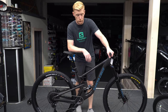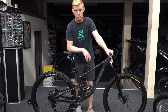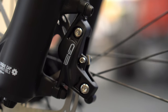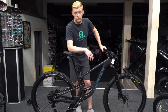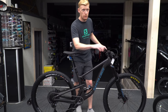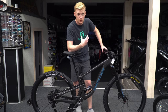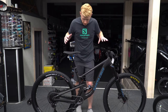The grips are the standard Santa Cruz lock-on single-sided, which work really well — really nice quality and great feel. Braking is the SRAM G2 series, four-piston. It's a bit heavier, kind of in the same family as the Guide stuff. The G2 feels a little more like Shimano XT — more on/off with less soft modulation through it. That's a super technical term but it's actually a really accurate way to describe how those brakes feel.